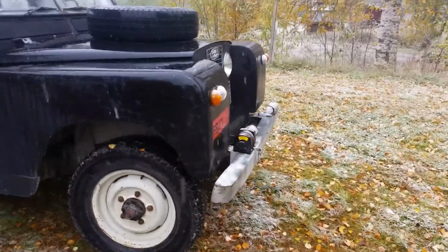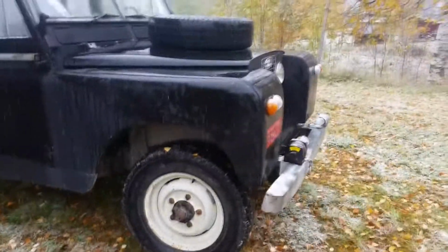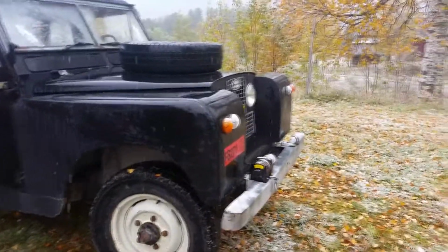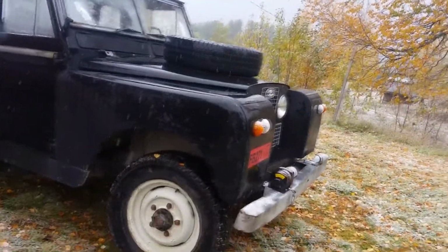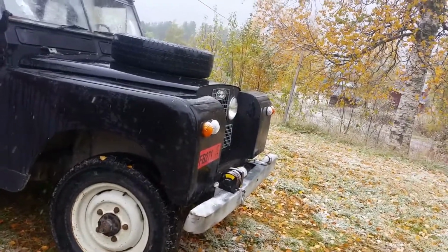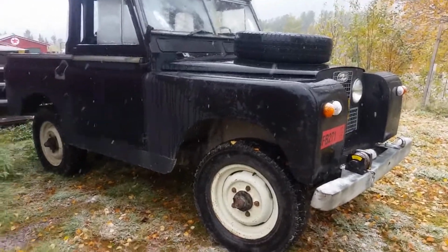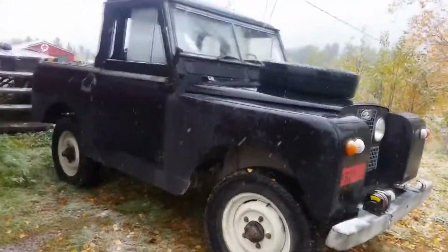Now, getting it in is a debacle of its own, because you have to lean down under the car as you put it in to see if you actually hit it. Then it's the cranking. And when this thing's cold, it's definitely not easy to crank over. You have to use a lot of muscle to turn it halfway around, and then it gets to the point where none of the pistons are on very much compression. So it kind of has a hard spot and then free. And then hard spot and free.